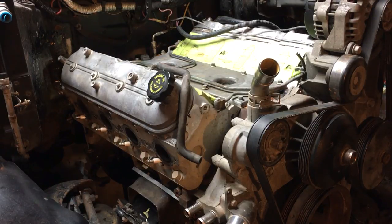I have leaf spring rear suspension. A lot of people don't realize that on a leaf-sprung car the rear of your vehicle is not supposed to squat - even when you launch at the track, it should hit a neutral position and actually lift, not bring the body toward the tire. Look that up in chassis books or online chassis tuning. Anyway, I wanted to go through a list of stuff I've done to the Blazer that I may not have mentioned in previous videos.